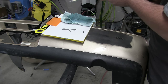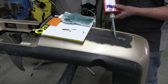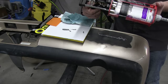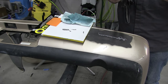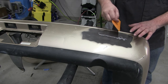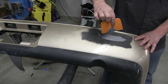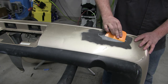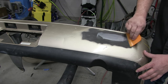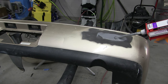Now we're ready to apply it to the plastic surface. I'm just going to apply it where it's low right here. Using a body filler spreader, I'm going to push down real hard to make sure I push it down into those grooves. Then I can loosen up on the spreader and do a fill coat, giving it a little bit more. I'm going to go ahead and add some more right there because that's where it was low.